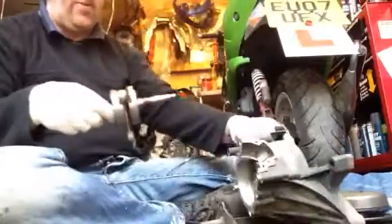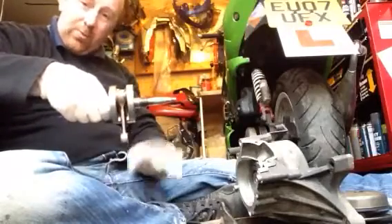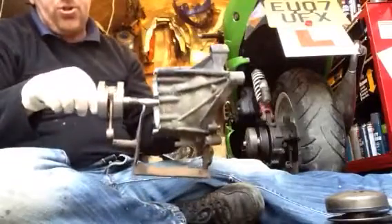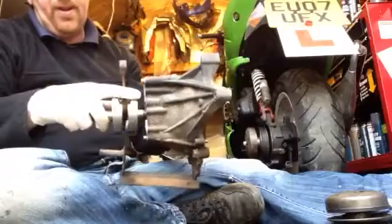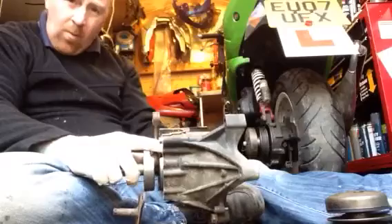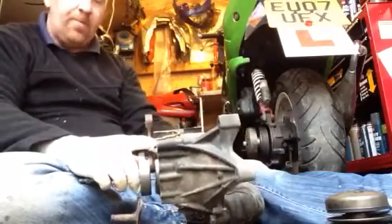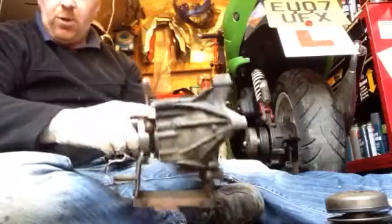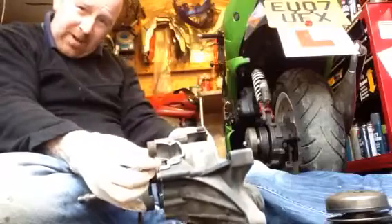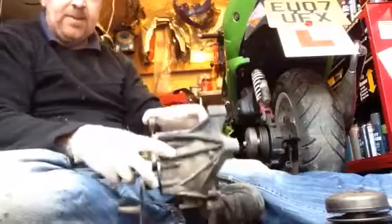Now this is what you should end up with - imagine the other side of the engine and you've got this facing you. You've done with this side, the variator's back on if you want to put it back on, it's fine. And what you're going to have difficulty now - obviously the stand's not on there normally - is you're trying to get this to go nicely back in here. What you'll find is you get to a stage where it won't go anymore. Which my friend's at now, and he's worried about how to whack it on. You don't. Push it on as hard as you can - must remember to keep this top dead centre.